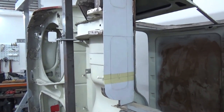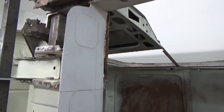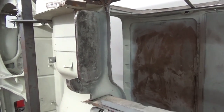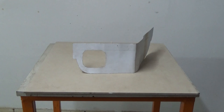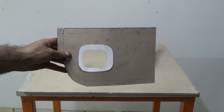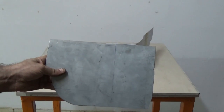After test fitting the new floor pans we made a template. This copied the curve on the inside edge of the floor pan. We then transferred this paper template onto cardboard and made a proper template to cut from steel. This is what we've cut so far. We did keep the lower section of the recess as it was in better condition — the top part was gone as you have seen in the previous part. We made a template to copy the size of the actual panel we want to remove, then a second template with the dimensions made wide enough to accommodate the flaps, which will be welded onto the body. After that we copied the cardboard template onto a steel plate, traced the outline, and then we're going to bend it and punch the recess in the center in the right location.